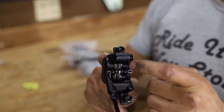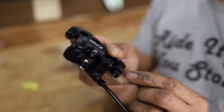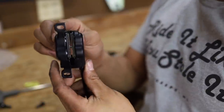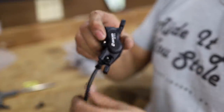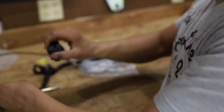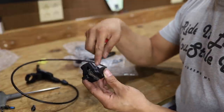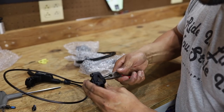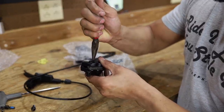So let's go ahead and look and see what we're dealing with here. This does look like a two-piece caliper - you can kind of see the seam going all the way through the middle. Obviously you've got a big old mounting bolt here and another one down here that's keeping these suckers pinched together. The adapters don't feel the greatest on the calipers - they feel a little cheap and a little chintzy. But it does look like we have a bleed valve here. The cool thing about these brakes is they actually have an option - if you want to run them internally, they'll sell you the calipers, levers, hose, barbs, and olives all separate, almost like an internal routing kit.